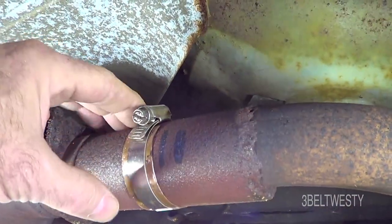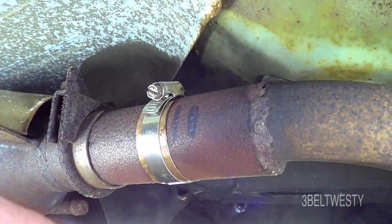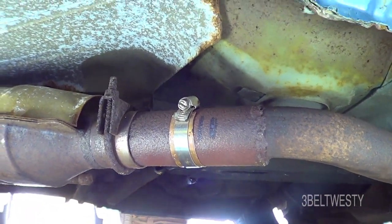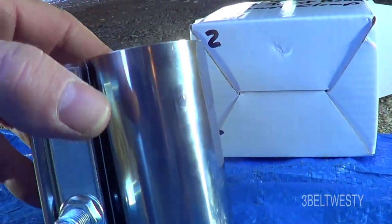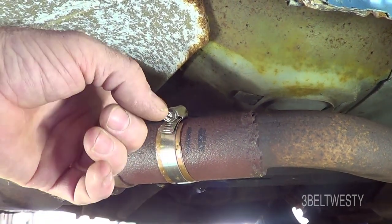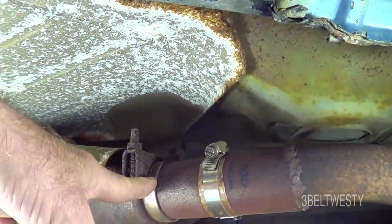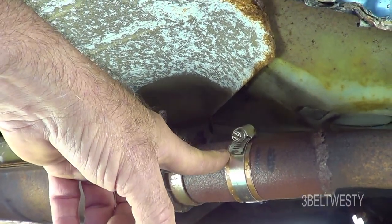What's on there now is just a wrap with a piece of copper and a hose clamp, and that actually seals pretty well — but it's not really structural. Without something more substantial on here, it's going to experience fatigue failure and bust. I might get a new pipe when I eventually get a new converter, but this was just a temporary fix.